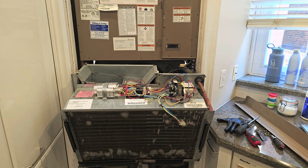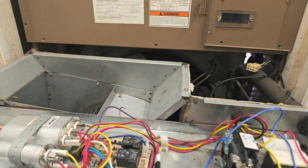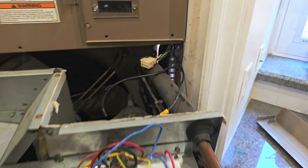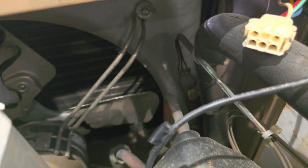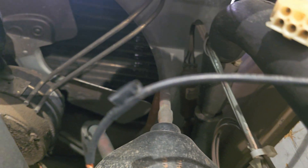The air conditioning section is like a window-mounted heating and cooling equipment. I've successfully pulled out the unit, so I'm going to show you how the unit looks. Here is my compressor, and I'm going to look at my fan and my condenser coil. The condenser coil is not too bad, but I'm still going to power wash it now that I have it out.